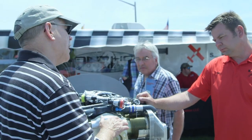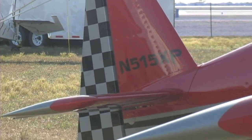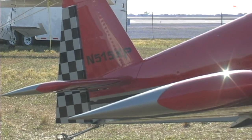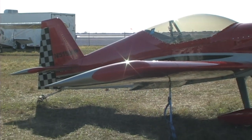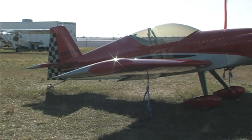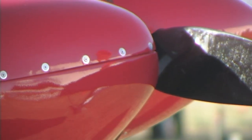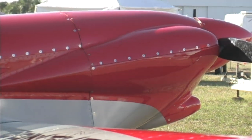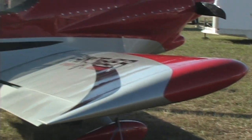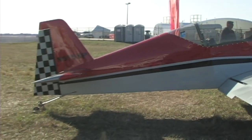With the extra power from this engine, you're selling an aerobatic-capable airplane. Will this engine handle aerobatics? This engine is just like the Corvair — it doesn't have full inverted systems. We're getting ready to run a Rotec carburetor on our Corvair so we can do some upside-down stuff. They have another version of this engine that does have an inverted oil system — we call it the ISA — and if you really want to fly upside down with flop tubes and the tanks, you put that on there. It's an option, maybe about $1,000 extra for the complete oil system.